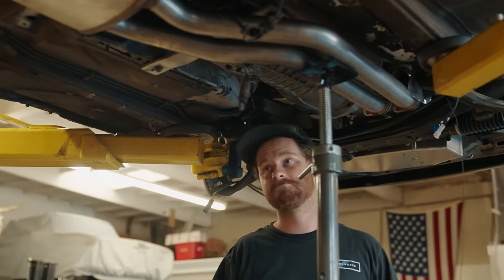About that front half — we've got a mate from the headers to the middle resonator, but unfortunately the pipes on here aren't very close to fitting, and with our aftermarket headers we need a different solution. I kept reminding myself this is supposed to be a quick and dirty daily driver project, but once again I got carried away. We're going to hand-build some TIG-welded pipes from the headers to the center section of the exhaust, routing them for maximum ground clearance and good flow characteristics. We'll keep the pipes parallel where we can and merge the sizing from the header to the midsection.